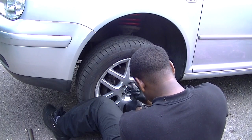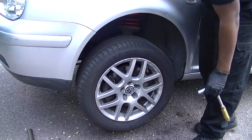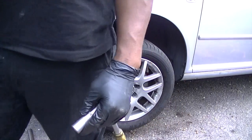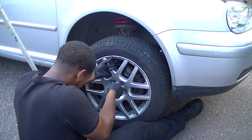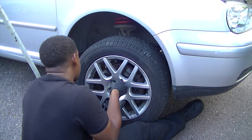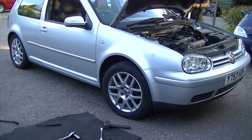Once you've done that, put your wheel back on. That usual stuff. Tighten it up properly. Make sure it's on the floor when you tighten it. And torque specifications once again, just to make sure everything's okay, because safety first, and do the same thing on the other side. You can see that I've already put that one on. There's no point showing you the same video twice.